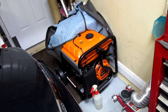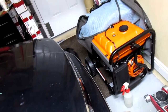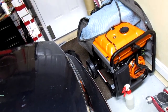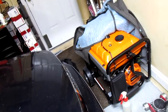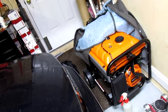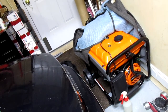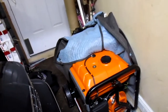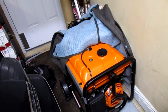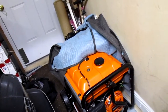Sometimes things that aren't mine wind up being my responsibility. I opened up the cap maybe two weeks ago while doing a service on another unit and the cap had rust all over it. I'm not going to open the cap and show you because I don't want the fuel vapor. When you store this thing full of fuel, you do not smell any fuel vapor — there's like a pressurized vent with a diaphragm that opens at a certain pressure and purges a little through the air filter. You do not smell any fuel with this thing when it's sitting with fuel.